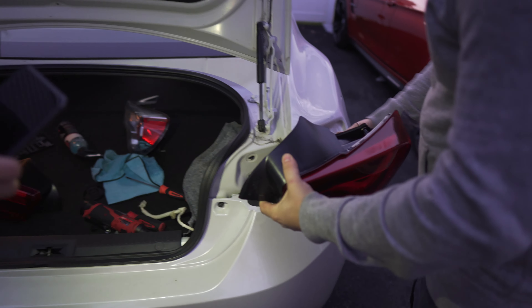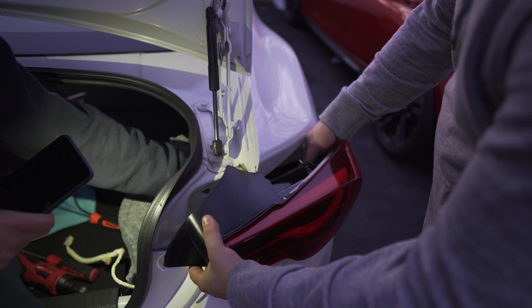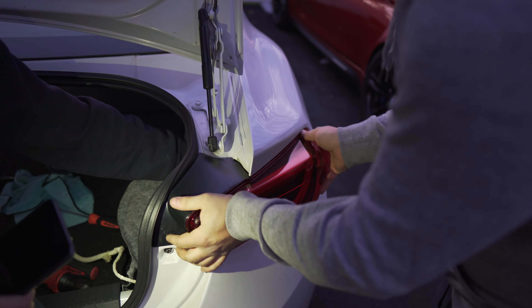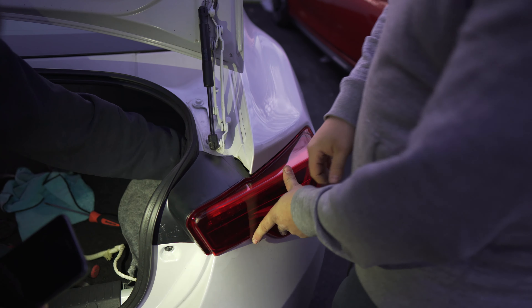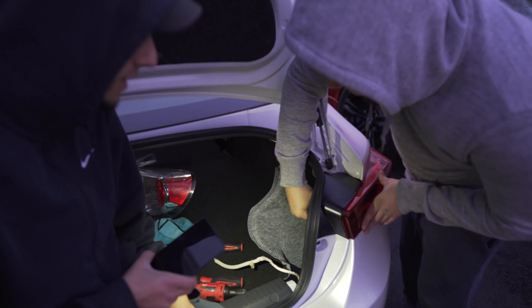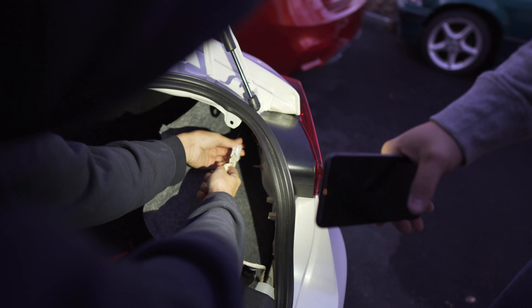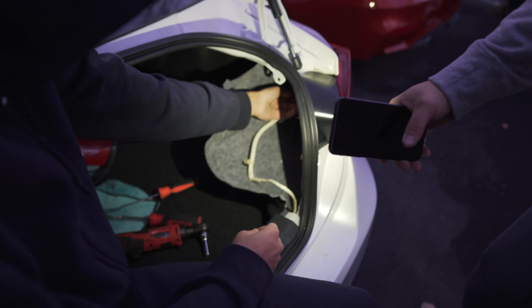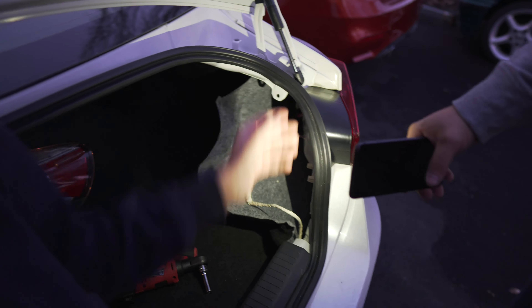Line up the holes. Take the old connector and connect it to your new tail light. Make sure the clips line up on top — very easy, let it clip. And then this is the switch for the sequential on and off. We'll see if it's on right now and test it out, and I'll show you guys how it looks.